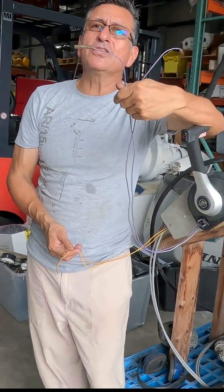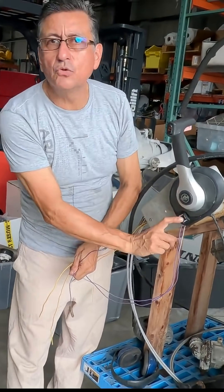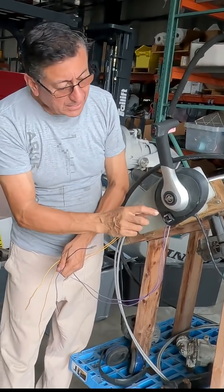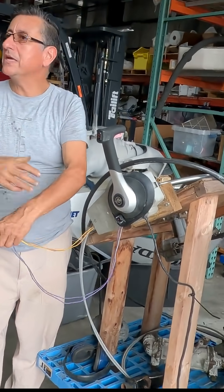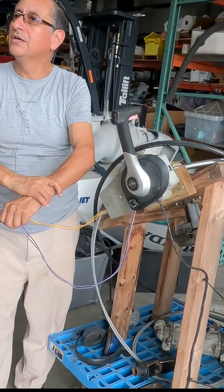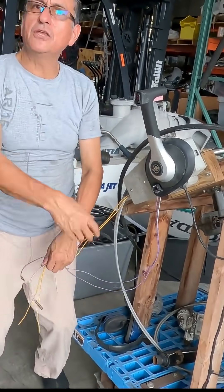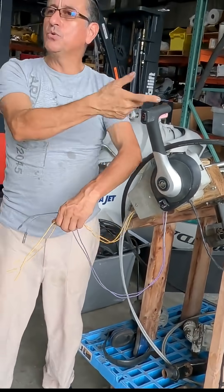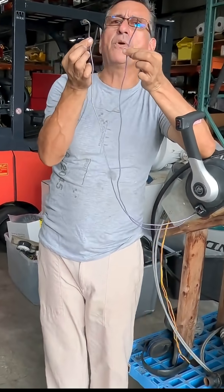This is the kill switch. This one is connected with this button — you know that button — to turn off the engine. That button is connected with the bracelet that you put on your wrist when you drive a jet ski or a small boat. If you fall in the water, it cuts the power and turns off the engine. You interrupt the ignition system with the purple cable.